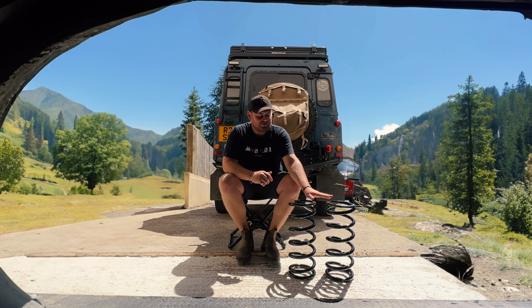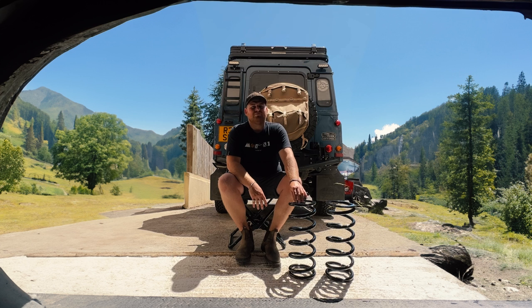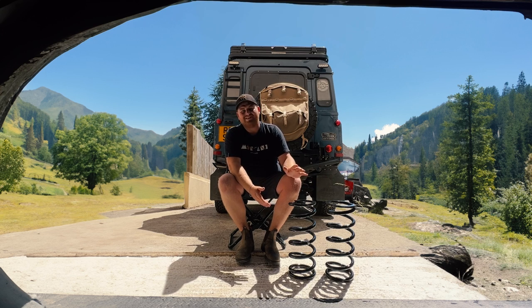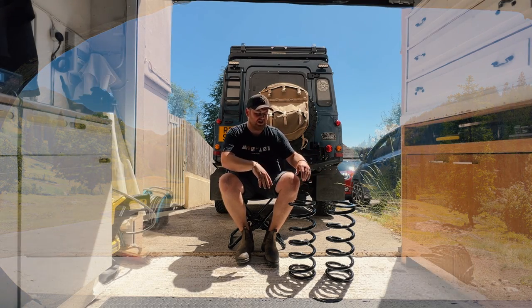So I just unboxed these new OME springs — these are plus 500 kilo heavy duty ones for the rear from Brookwells. I picked them up the other day. I'd previously picked up some 300 kilo ones thinking they'd be a good compromise, but it turned out they were medium duty rather than heavy duty. I put them on and they were no better than the ones before. They'd be great if you've got less load, but for me with a roof tent and camper it was all a bit heavy going around corners at 50 miles an hour on a B-road — just feeling a little out of kilter. So I've opted for these 500 kilo ones, with the option to also go for adjustable airbags in the centre later if needed.